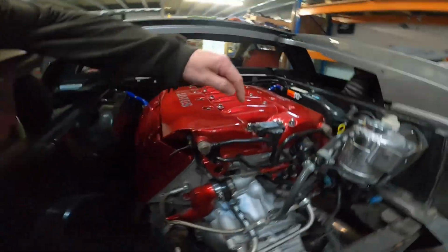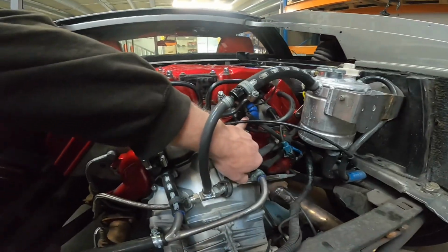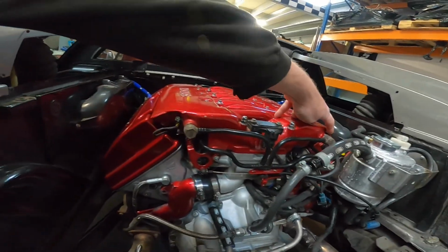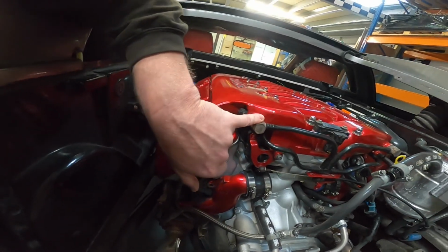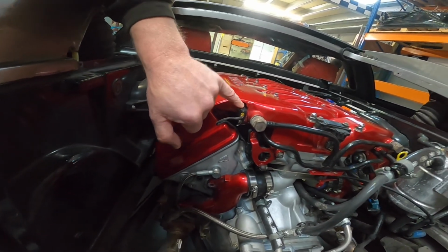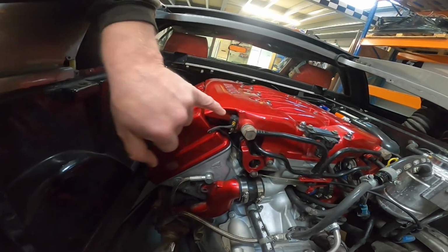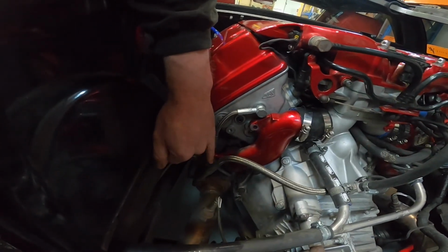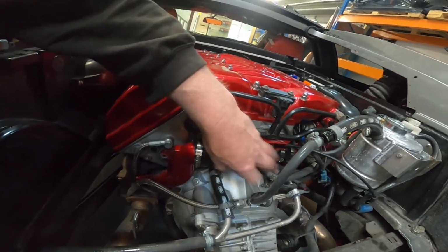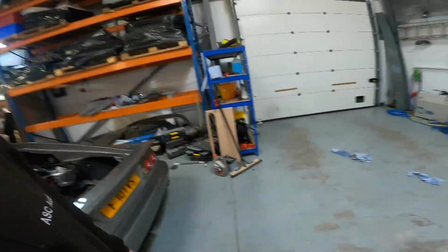So how this works is you've got 4 injectors through all the cylinders. So 1 rail there and 1 rail inside there. And then at the top, you've got 1 here and 1 there, and they're the secondaries. This primes with fuel off the back of the fuel rail, comes out here, and fuel sits up here in pressure. And then when you give it large, these injectors open up and allow more fuel into the intake to give you extra power. Now this, no matter whether it's on or off, is weeping fuel straight down the throttle body, and it basically filled up this turbo with fuel. And as we started it up, it went in a rather worrying fashion and covered the side of the engine in fuel and the back of the gearbox. It was everywhere. So a bit of a squeaky bum moment, which I didn't enjoy.